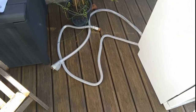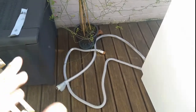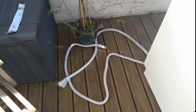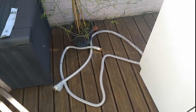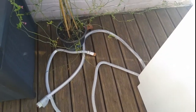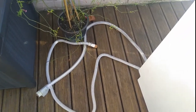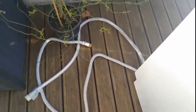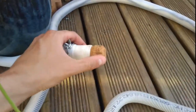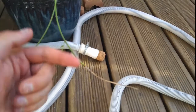The first thing to do is disconnect the water — turn off the water switch and disconnect the terminals. Make sure you've got a towel because there's going to be a fair bit of water in the pipes. I've used a cork to block both ends of the pipe.